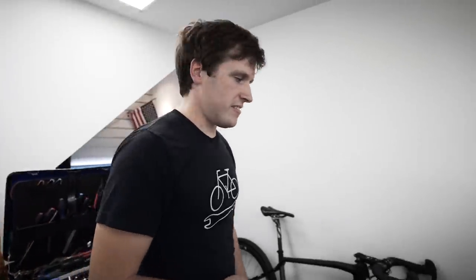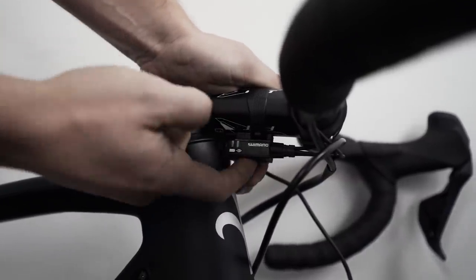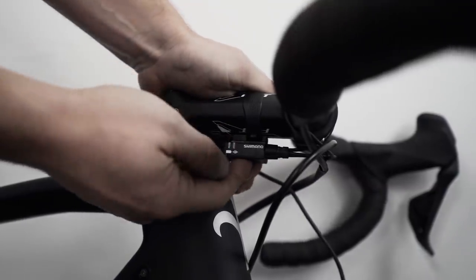So one last thing I wanted to ask you — the synchro shift. How do you turn that on and off without plugging it in? There's a way to do it just on the bike. When I picked up my TT bike, it was stuck on full synchro. The idea is for chain lines — it automatically drops onto the small ring and down a few sprockets at the back rather than allowing you to cross-chain, which gives you better drivetrain efficiency. Because I'm already doing that naturally from years of using mechanical, is there a way to turn that off completely with Di2? Yeah — you press it twice, two flashes is semi-synchro. Press it again, three flashes is full synchro. Press it again, solid, and that's back to normal. It's like your bike's got a mind of its own sometimes and I just want it normal — I want the efficiency and smoothness of Di2 when you've got cold hands, but without any messing around. Exactly, because otherwise robots can take over the world. Bikes will ride themselves across Vietnam. Shimano net.